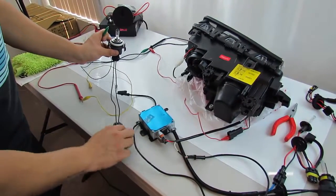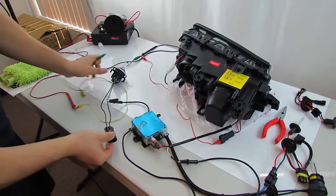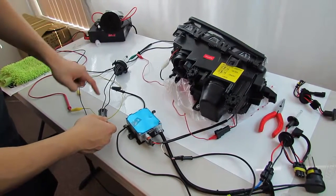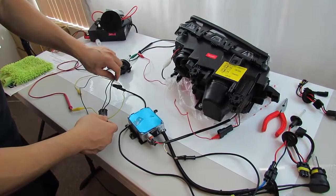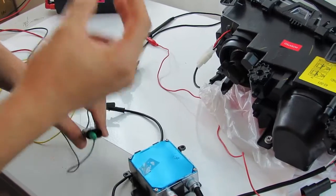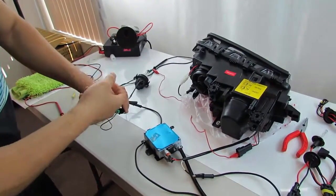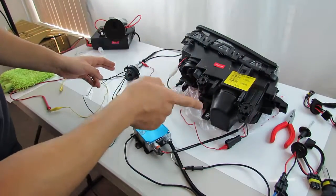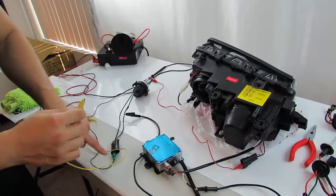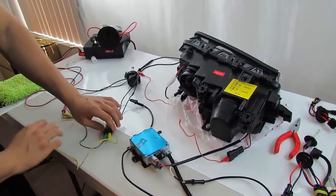This is a positive wire. You want to make sure that the wire that's been tapped is your positive wire. Looking at this, I know one side is my grounding negative, so I'll ground the pin to the left — because this side is not tapped, I'm assuming it's the grounding negative, and the tapped wire is the positive. When connecting your connector, check whether the high beam connector has a black or brown wire — that's most likely your grounding negative. Make sure you have the orientation correct, because it will matter for the Bi-Xenon function, though not for the halogen bulb itself. The green and yellow connectors are your high beam factory connectors. Make sure polarity is correct, otherwise the high beam Bi-Xenon system will not work.